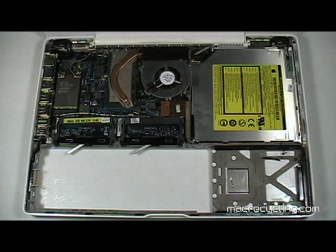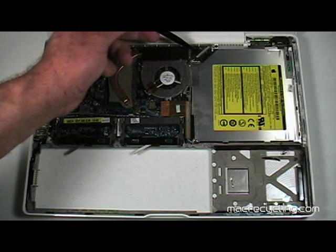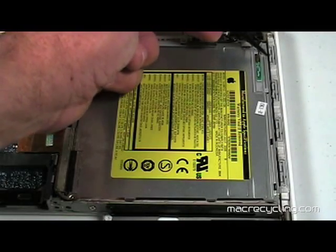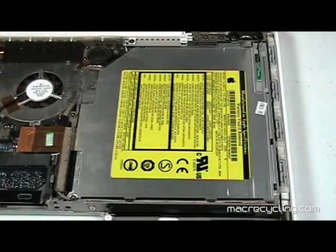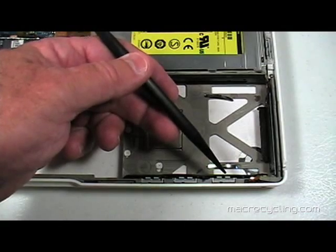This is what you see after the MacBook's top case has been removed, with the battery connector at the front left, the hard drive bay at the front right, and the optical drive at the back right. Notice the gray plastic clip at the base of the display assembly. This is one of the four clips to the right of the optical drive. These clips are easily dislodged and misplaced, so take care not to lose them. The four clips are located here. The three clips toward the front are not easily removed and should be left in place.